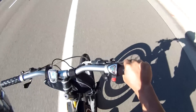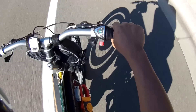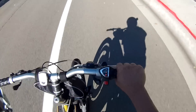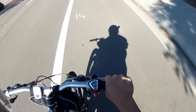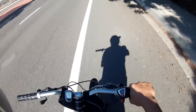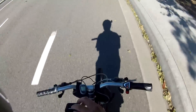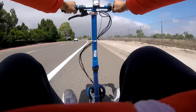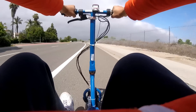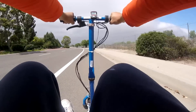Because this motor is a brushless motor, over-voltage is not really a big deal since it doesn't produce as much heat as a brush motor. So I think the 60V battery will work just fine on this bike. Overall, it was a successful test on both my electric scooter and my electric bike. But if you want to do this, do it at your own risk for two reasons: number one, it might burn out your controller because of over-voltage; number two, running at this speed is extremely dangerous, especially on that Razor electric scooter — I was really struggling to control the wheel because of so much torque. Thanks for watching and I'll see you next time. Bye.